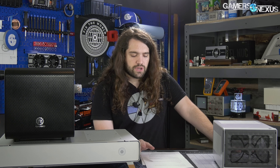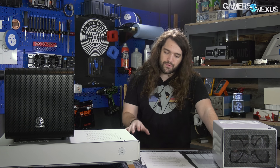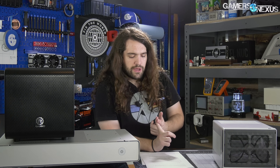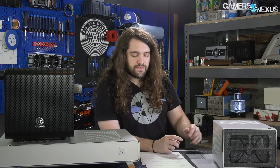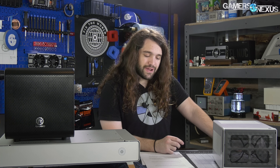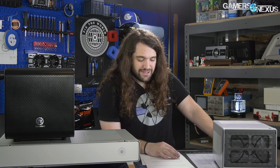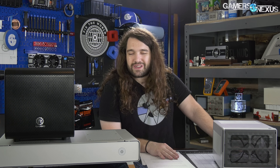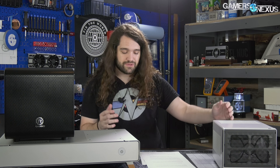So we can go through all of these. Case dimensions are probably the most important factor when selecting an ITX case. The CryoRig Taku measures 25.1 liters, or 14.8 liters excluding the legs. The Core V1 is 22.7 liters, and the SG13 is an impressive 11.5 liters. You could fit two SG13s in the other cases if stripped to bare components. That puts Silverstone in an interesting position — smallest by a significant margin, but it has a mesh front, making thermals very interesting to evaluate.